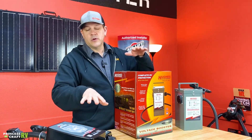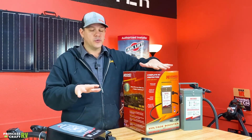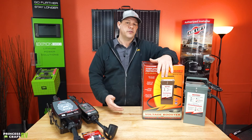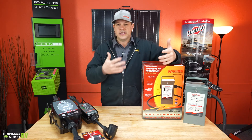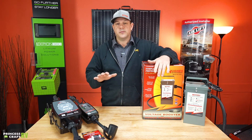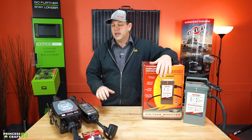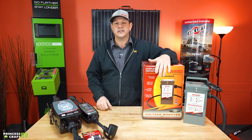One other thing I want to mention is that Hughes has paired with RV Whisper. You can actually connect your Bluetooth surge protectors through the RV Whisper products and get notifications on your cell phone even if you're out of Bluetooth range. You do need wifi in the trailer for it to work — it's all cloud-uploaded and will send notifications to your phone that way. You can actually be miles away. This is really great for people who travel with pets and keep them in the trailer. If you're concerned about a power outage while you're away, pairing it with RV Whisper means you can get those notifications and know if you need to head back to the park to take care of your animals.